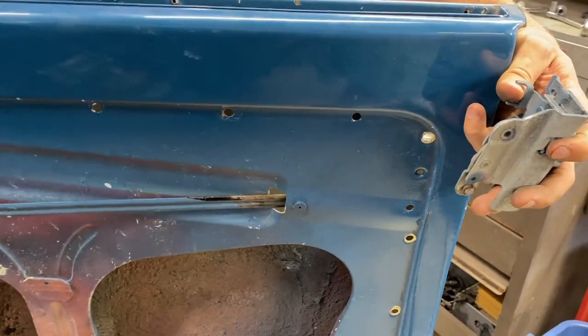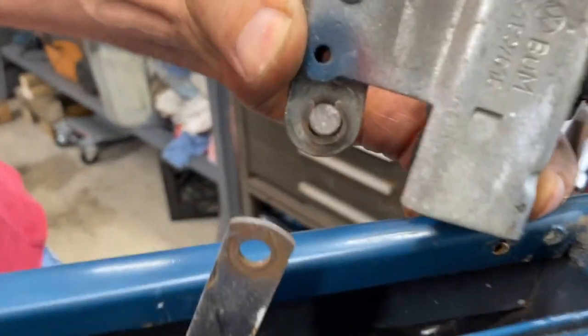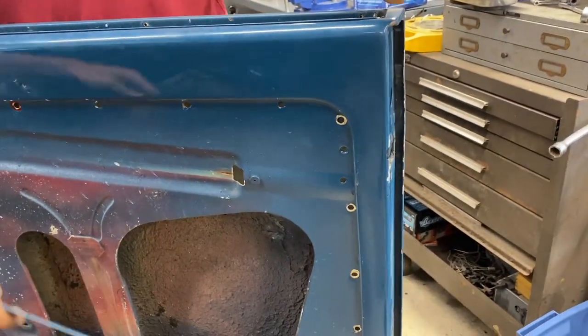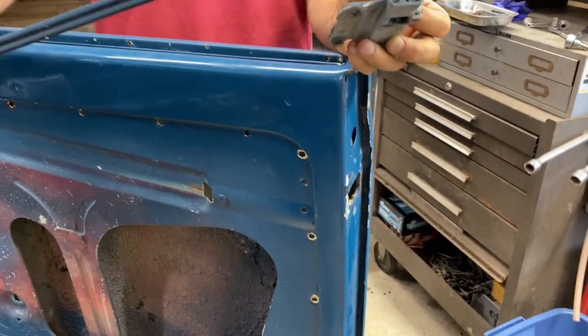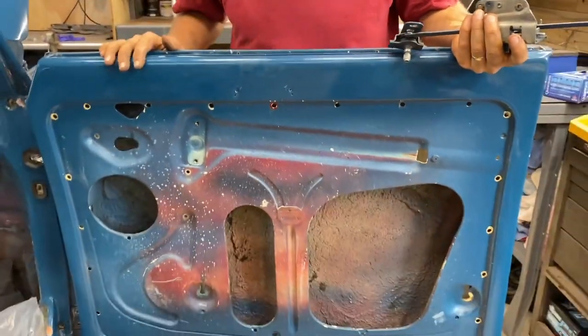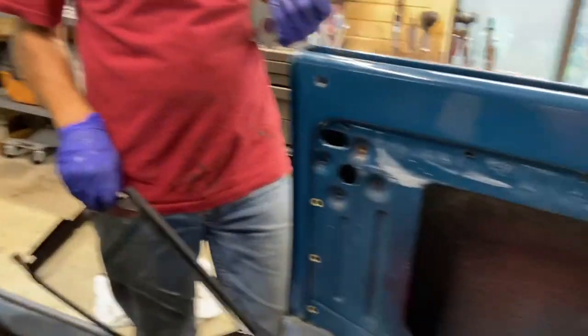Having this piece in, you can't take everything out — we needed to raise it through so we could pull off that little C-clamp, which is actually a snap ring. Take that off, and then we were able to separate the two pieces so we can clean everything up without it all being painted and glued. This door is pretty much done. We took the little bump stop off. We still need to do the limiting strap and the hinge before this door is complete. Front doors are off, windows are out — on to the rear.